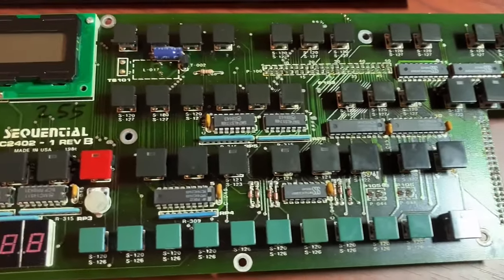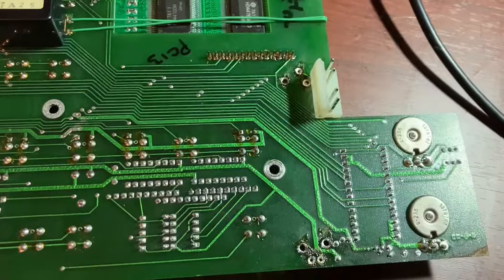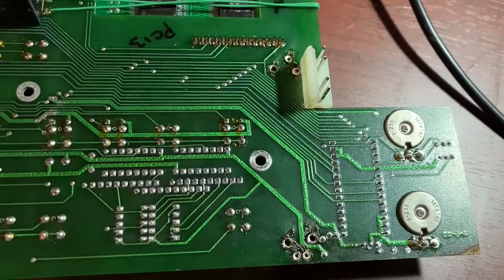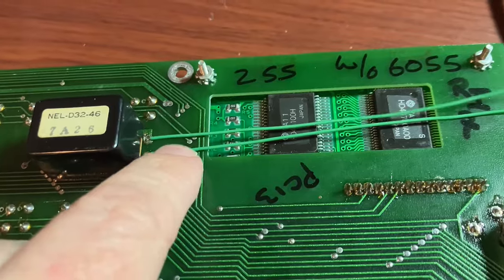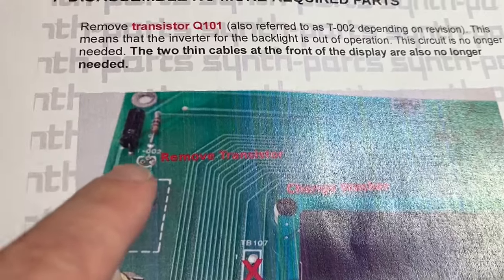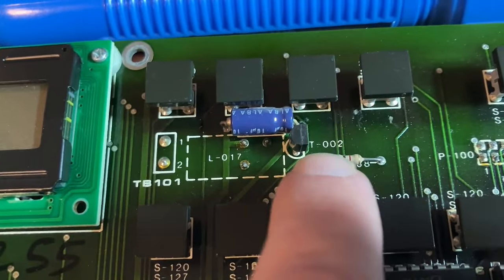Here's the front of the front panel board. Let me tackle the slider here first. I managed to get it out of there without lifting any of the traces or melting anything. I hope the new slider fits. New slider soldered in. This is connected to the backlight, which we don't need anymore, so I'm going to clip these. The instructions say to remove transistor T002, which is hooked to the backlight transformer. Here's the backlight transformer and here is T002 — let me clip that out.